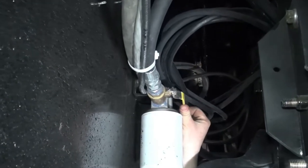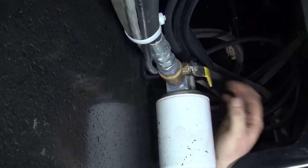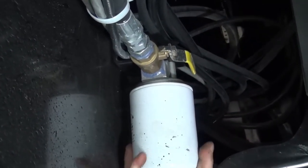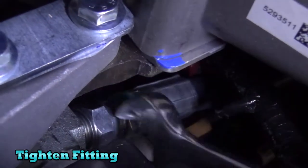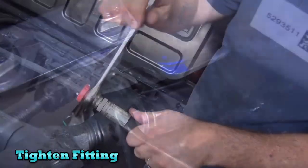In the pump, there is a filtration vent that will remove any straggling air that hasn't escaped from the cracked line. Then you'll want to tighten the fitting on the line you just cracked under the hood — the same half turn as before, only away from you.